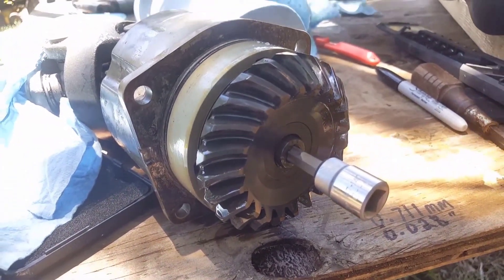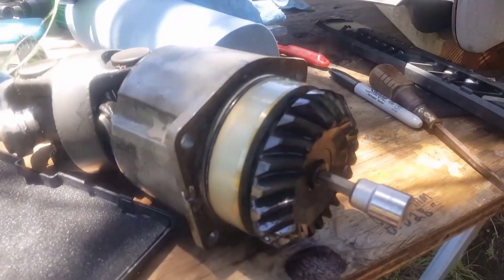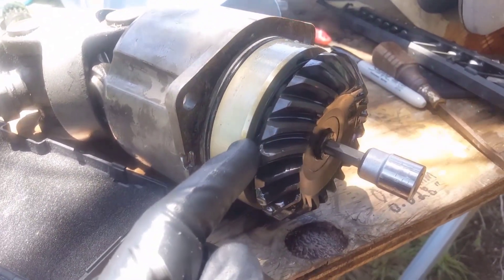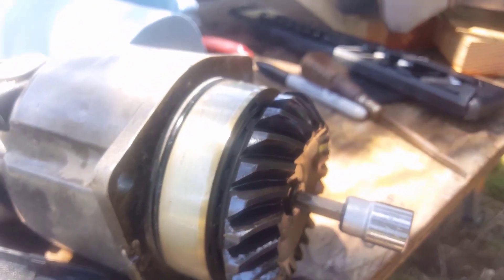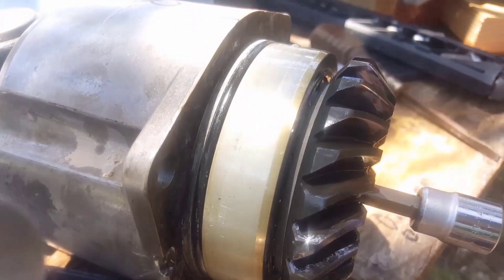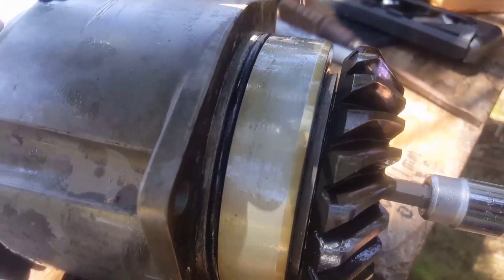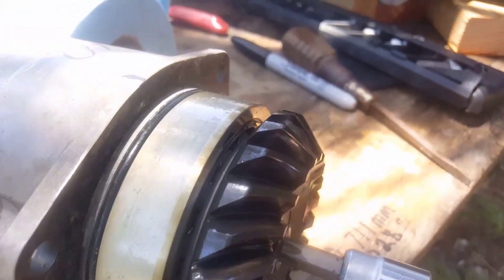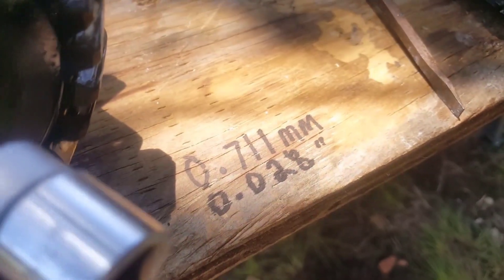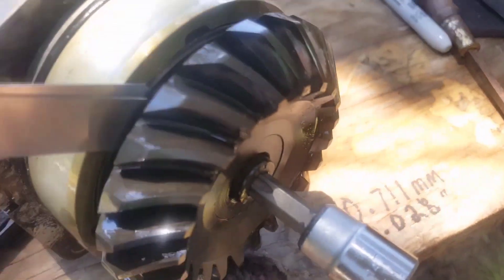It's going to be a T50 — it may vary on yours, but it's T50 on this one. One of the things I want to show you is how we're going to capture the baseline measurements as it pertains to the distance between the inner race and the gear, which is kind of important. I've also got a feeler gauge — there's a little crack right in there. I played around with the feeler gauges and the measurement is 0.028 of an inch, or 0.711 millimeters, and that's between the pinion gear and the race.